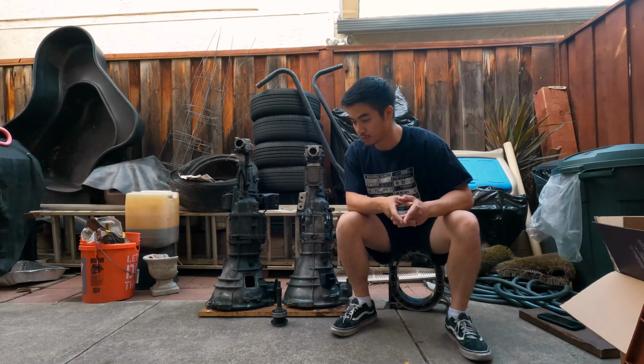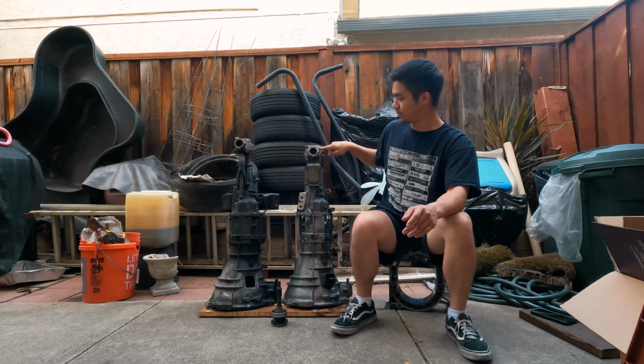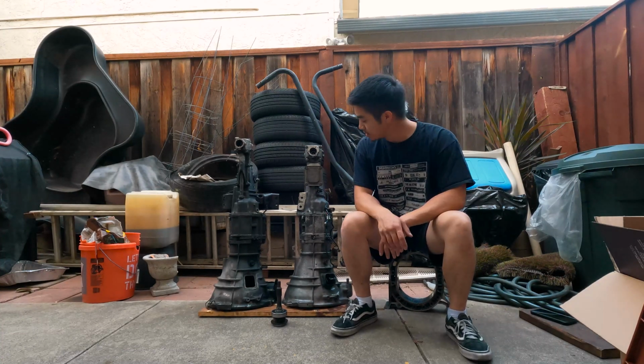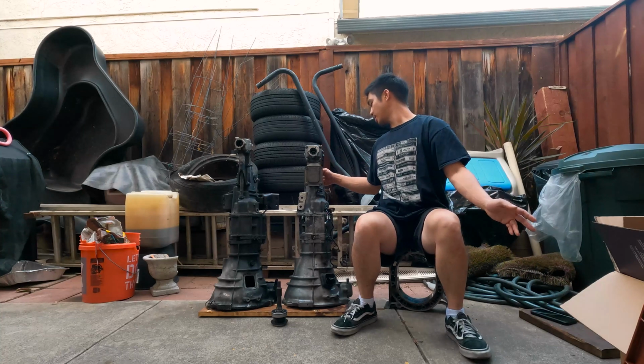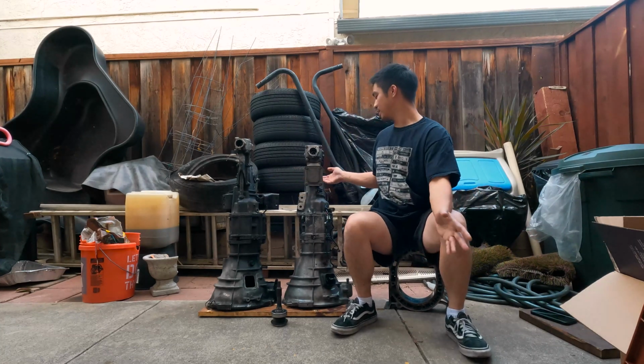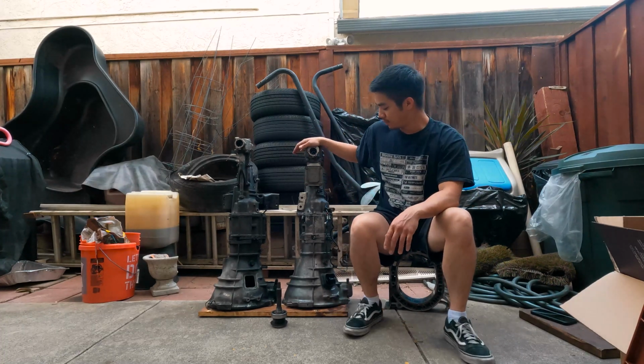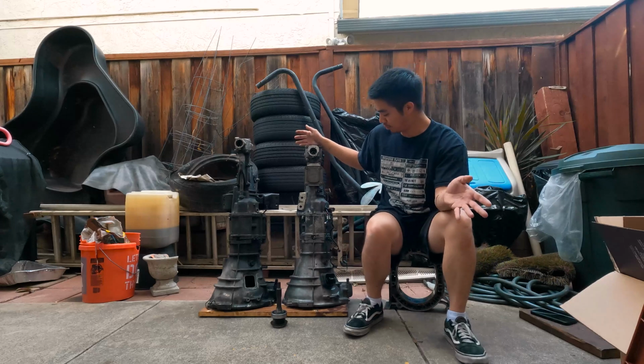The first benefit is the gear ratios. The other benefit is the NB shifter turret, a much better feeling shifter. The only downside of using an NB trans is now I have to use a different transmission mount. An RX-7 one mounts down here, but an NB one doesn't have the same hole, so I gotta do a little bit of improvisation. Well, since this guy's finally built, the last thing to do now is to throw it in and drive it.